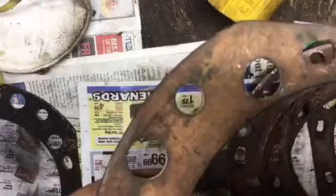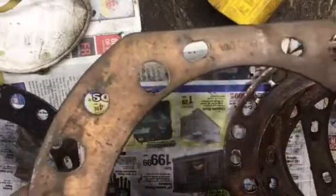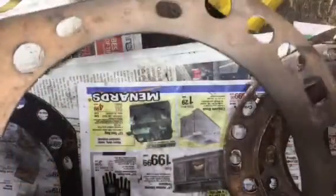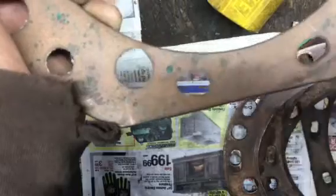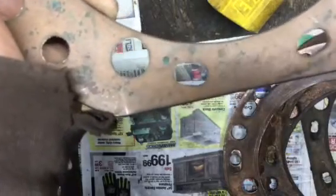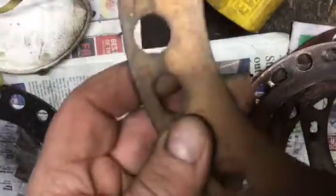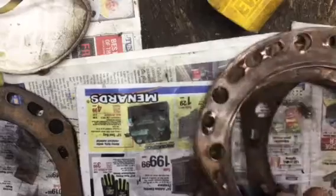Here I was going to point out it's a Victor gasket. There's a C3 on it. And this is probably the part number. I think it's 207A. But I'm sure that number isn't available anymore. So, like I said, I'm going to use the two NOS ones and the best two out of the four of the used ones. I've already picked out one that I've cleaned up.